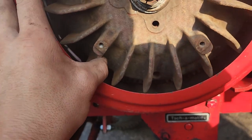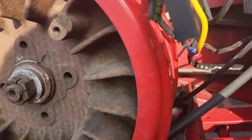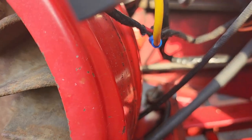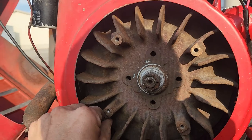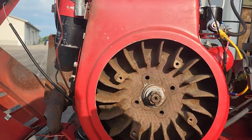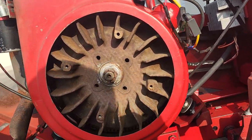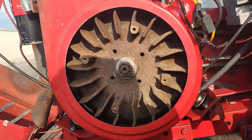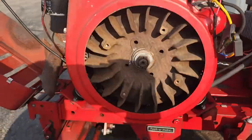See that — that's me moving the flywheel without moving the whole engine. I can tell the engine isn't moving because the belt isn't moving back there. Look how much play that is. I'm going to go ahead and pull this fan shroud off, pop that off, and see if that confirms it — then this 14 horse is gonna need a rebuild.